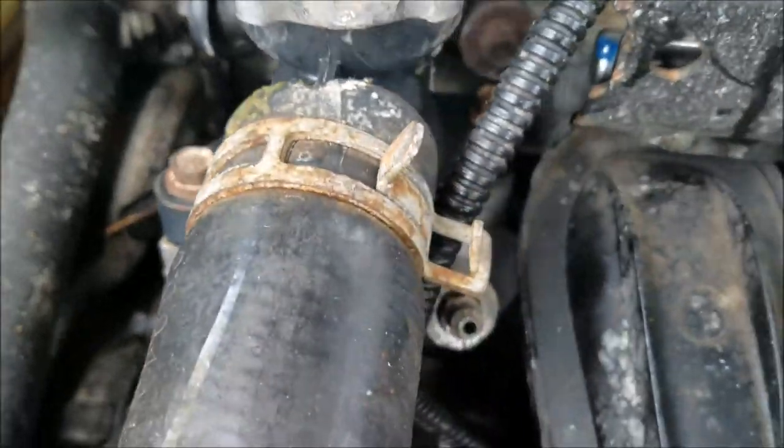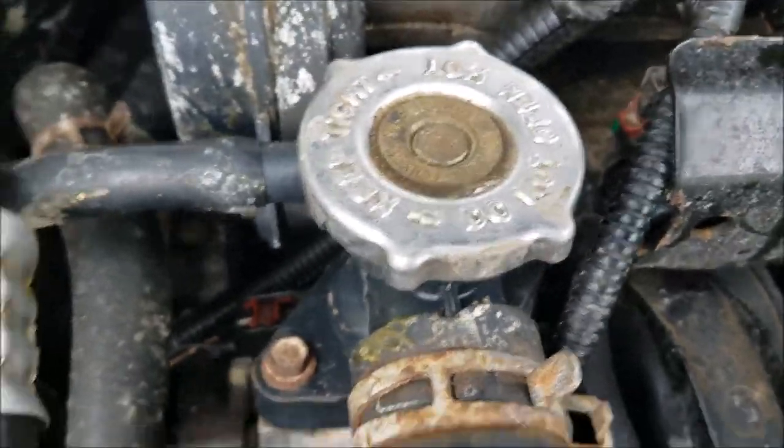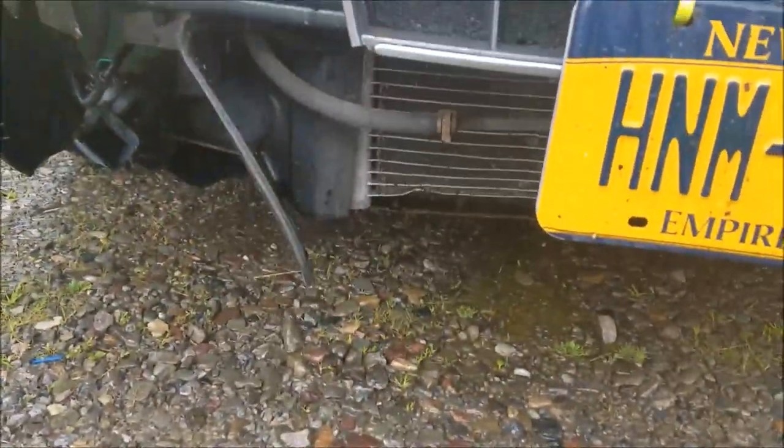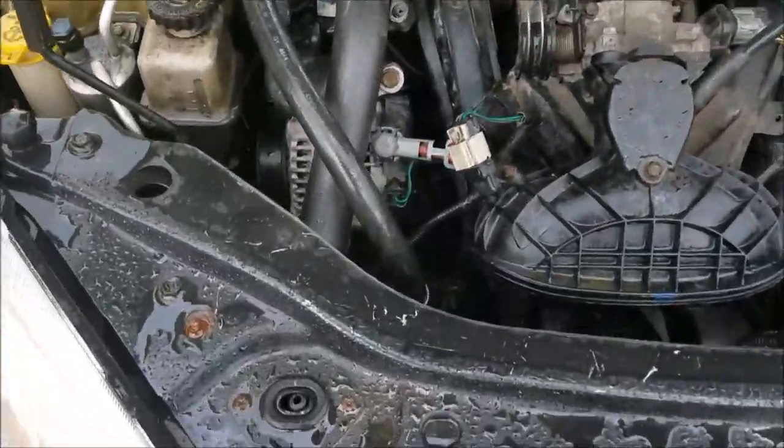Hey Daniel and welcome to my vlog. This one's about my daughter's 2003 or 2004 Chrysler Sebring. The video before this covered a cracked thermostat housing — I bought a brand new one for about 21 or 22 bucks and installed it. Well, come to find out, not only was that cracked, but you can see steam coming out down here and antifreeze leaking underneath, telling me we've got a cracked radiator as well. Stay tuned for that.